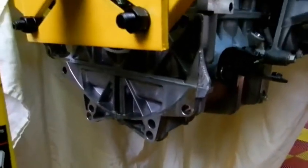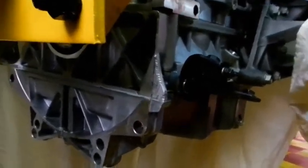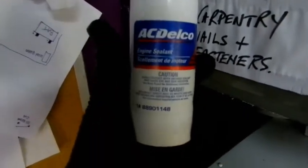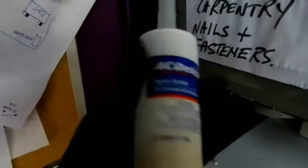The oil pan is in place. I'm a little upset I didn't get that video because it was a good one — it showed the correct method for applying the sealant. These oil pans don't use a gasket per se; GM provides a very special sealant — a white paste — and once you apply it you've got about half an hour to get everything torqued down.